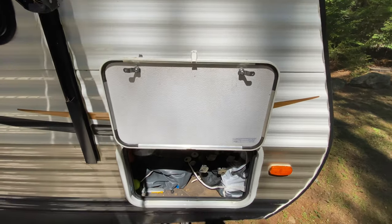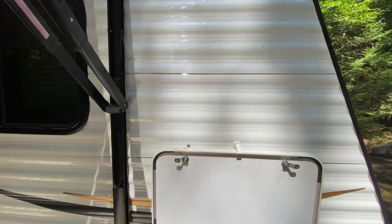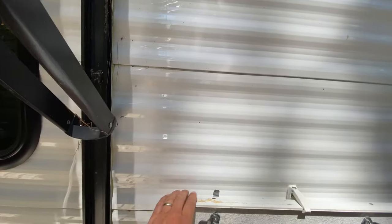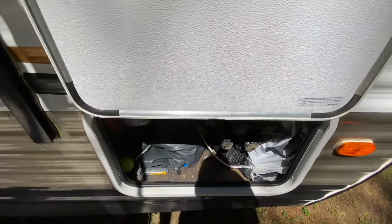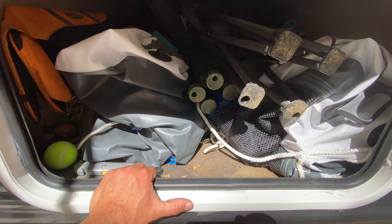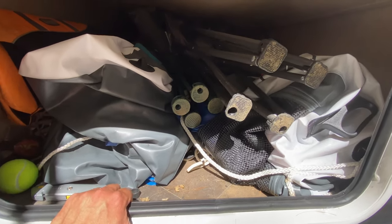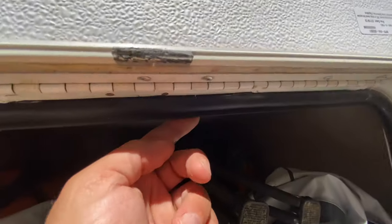I came up to the campground and it was really hot for two weeks — this whole compartment was absolutely dry, no water whatsoever. Then I turned the air conditioner on, and I could see water running down the side and right over the cover of the storage compartment. I let it run for a couple of hours and noticed it was getting spongy in there. When it was dark out, I took the flashlight on my cell phone and inspected the weather strip seal right here, and I noticed water was actually dripping between this metal flange right there and the old gasket.